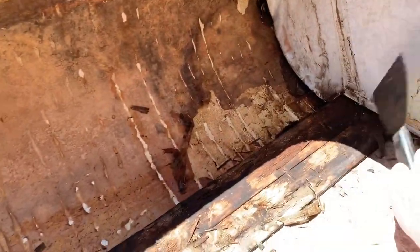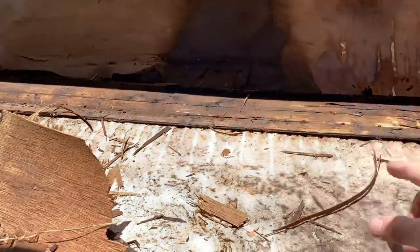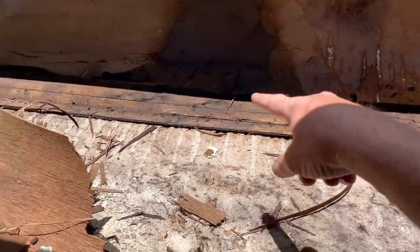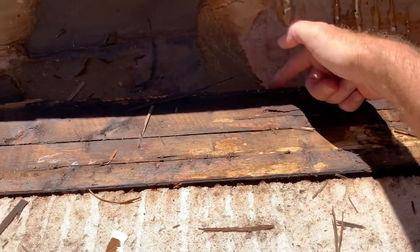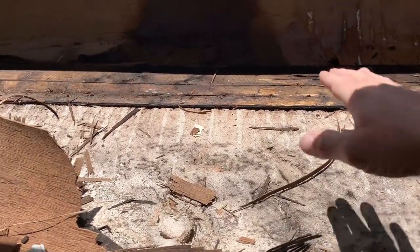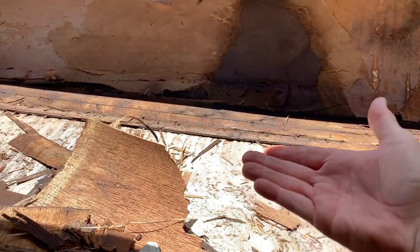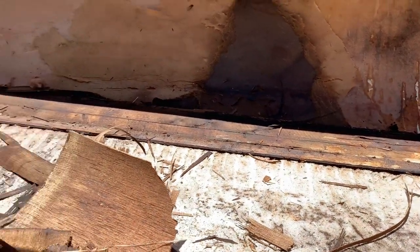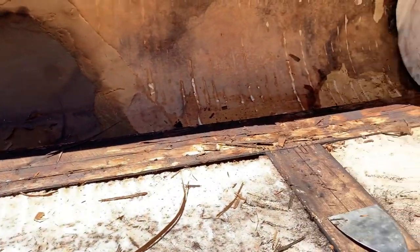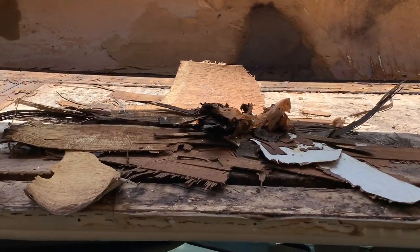I'm going to let it dry out. It looks pretty good — if I let it dry out, it should be all right. What I'll do is jack this framing up and I might put one more 2x3 here on the inside of this lip. Screw it to the inside or pocket hole it to the existing framework while the cab-over is leveled up with jacks from the front side — using 4x4s and some slide-out stabilizer jacks — and get all the rest of this framed in. That way when I let off the pressure on the jacks from the outside, it'll all hold together.